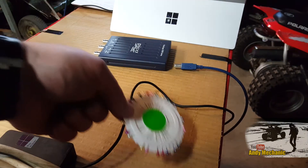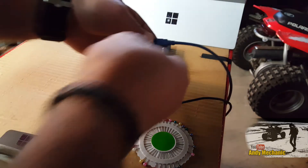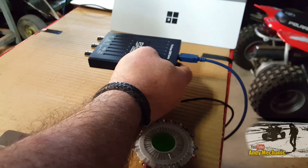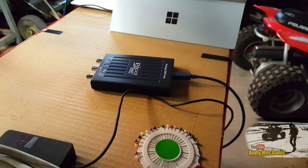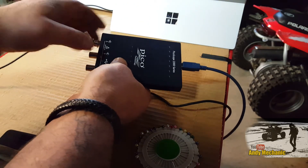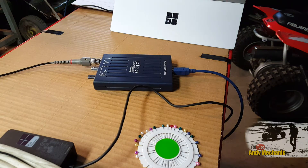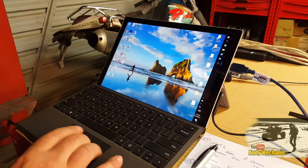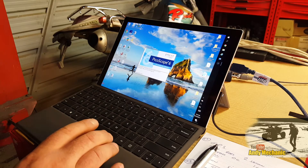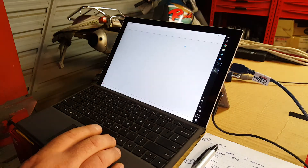That's how you buy those little pins - real cheap and cheerful, about $2 for a pack. Now we need to plug the PicoScope into the USB - that powers it up. We're going to be using channel A for this one. It makes no difference, you can use A or B, but A is the one you want to use first. Let's head over to the laptop and start up the PicoScope - click on the icon, takes a few seconds to come into life. Let's see what this injector looks like.